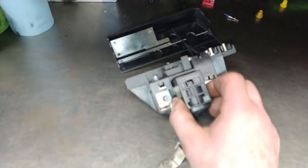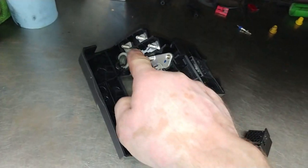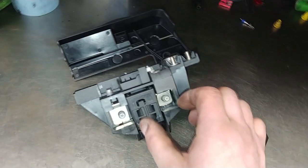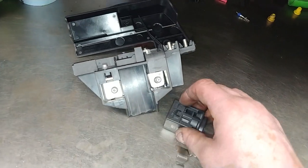So when this is installed, you have battery power here at multiple points, but there's no battery power to the starter — the vehicle will not start, the starter does not get enough juice to start, because this fuse is broken.